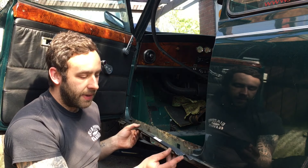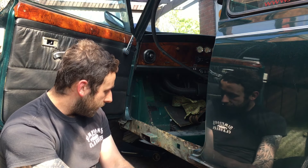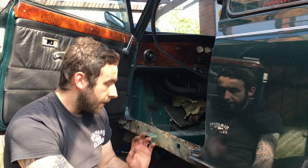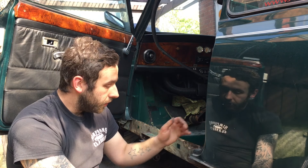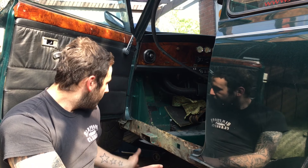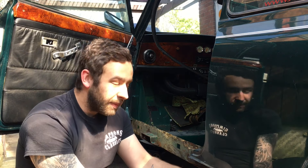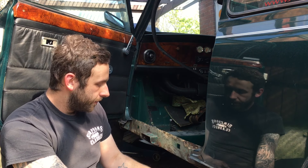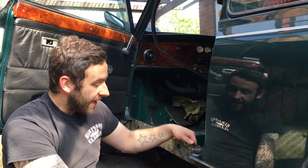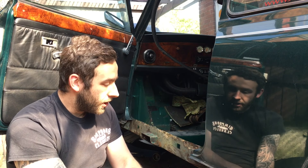Lining up wise it goes straight in — it's a bit bent in transit but we'll sort that out once it's in place. I'm quite happy with that, glad we've taken it out. It's confirmed that all this is just surface and I can really get in and see the safety points, which is the seatbelt anchor, because the whole point of this is the car's corroded and you want to be safe. There's loads of wax all over this — that's proven that the car's been cared for. Two repairs and then basically I'll put a front half of an inner sill in, probably from here forward. A little bit less than the other side, but we are putting the same amount of panels in. The seatbelt anchor on the other side is completely, completely gone, so this gives me the chance to sort it out — they're only tacked on, so I can repair this and put it back.